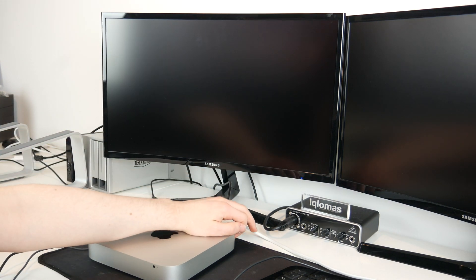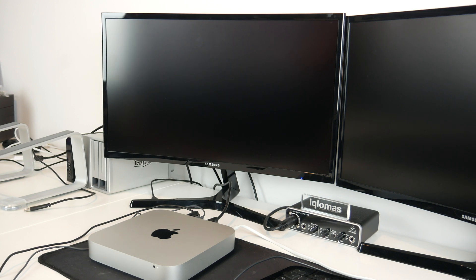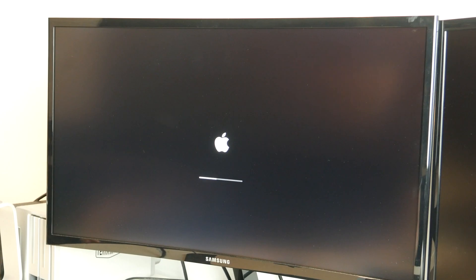I'm going to plug it into the back of the machine and turn it on. We may just get a blinking question mark because it can't read from the internal, or it might see that there's a USB drive plugged in and boot from that. So far we've just got a black screen. Oh — we've got an Apple logo! It must have recognized the installer, and now it will boot off there and then we can install macOS.